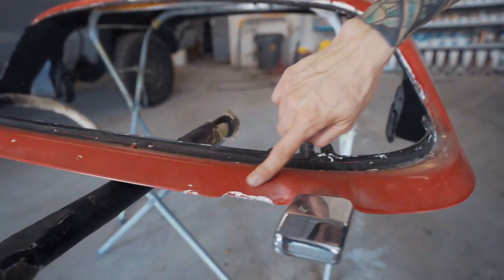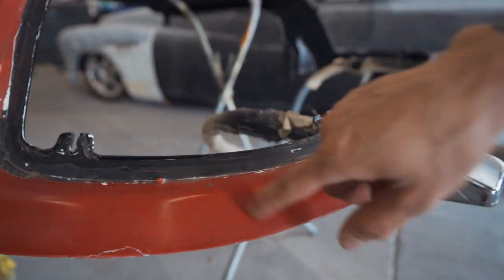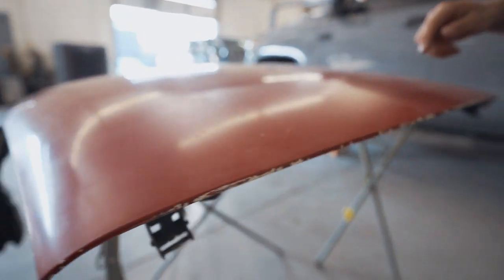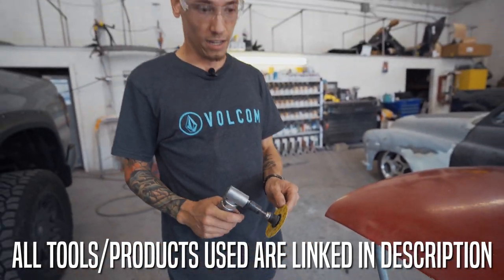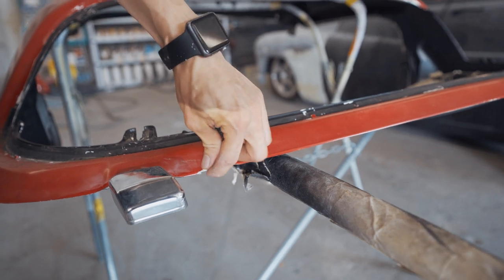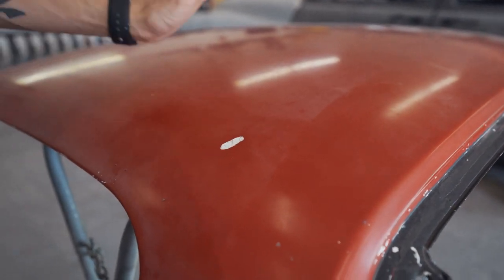You can see there's damage here — it's a fiberglass top with chunks of fiberglass missing everywhere. It's definitely been beaten up: a chunk missing there, one about to break off here, a big scrape here, and rock chips all across the front. I have a small angle grinder with a 36-grit disc to grind into the fiberglass and remove all the damaged areas, basically feathering all the chips back until it's not chipping anymore.